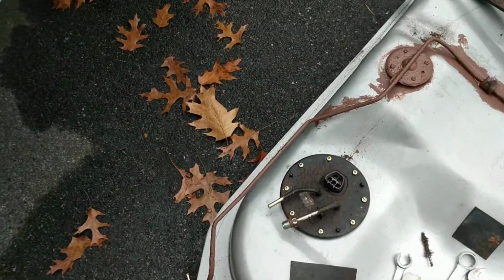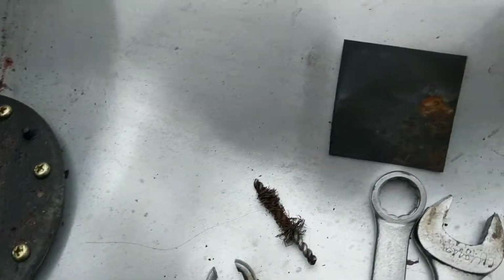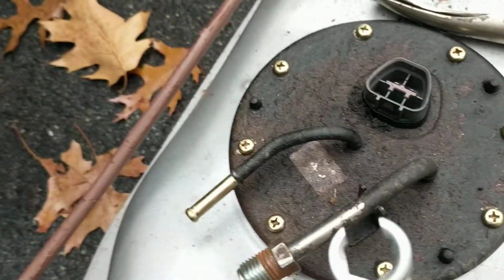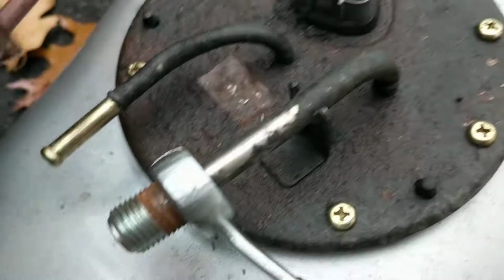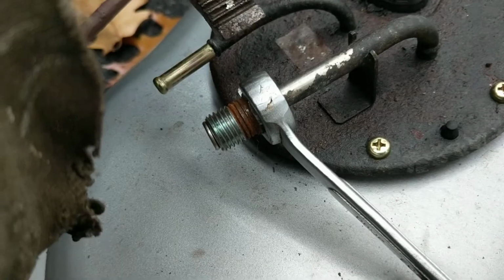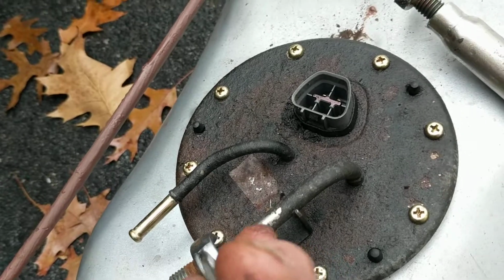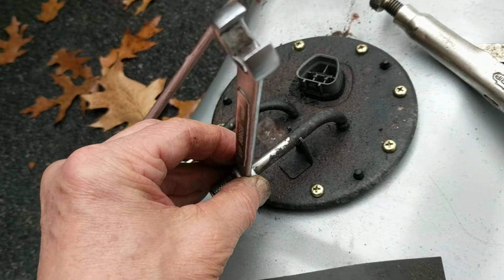And now, here's a trick that I actually read about online, and I used it in this case. And the idea is to use vice grips. After you put the flare wrench on, you actually use vice grips to clamp down on the two jaws. And you can really crank a good set of vice grips. And that actually will keep these from spreading. And that will allow you to apply more torque on this.